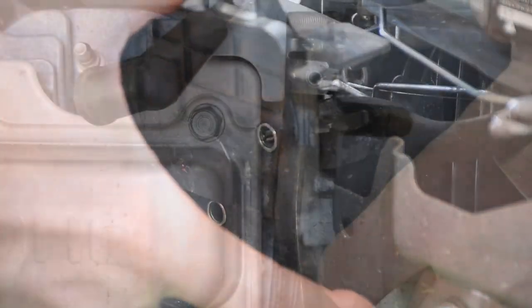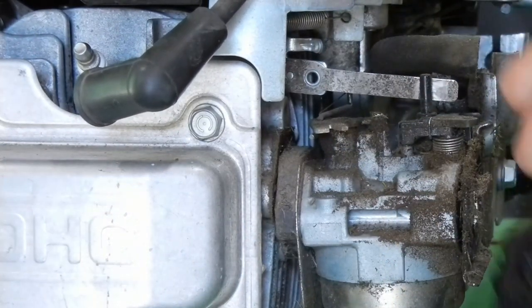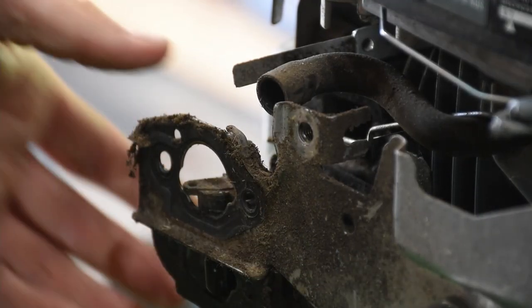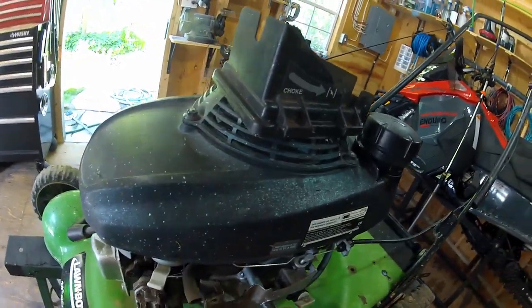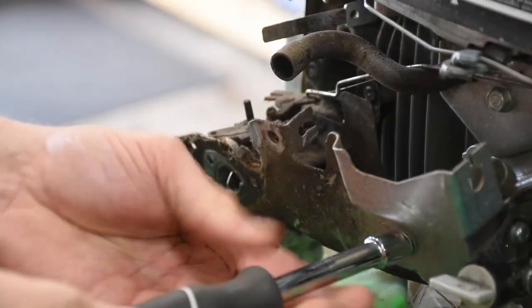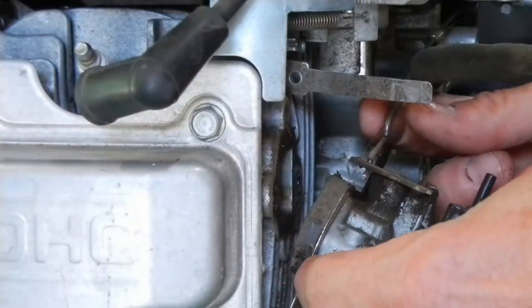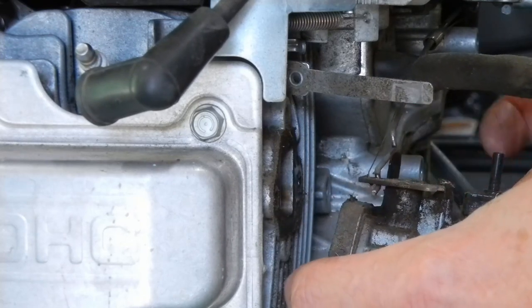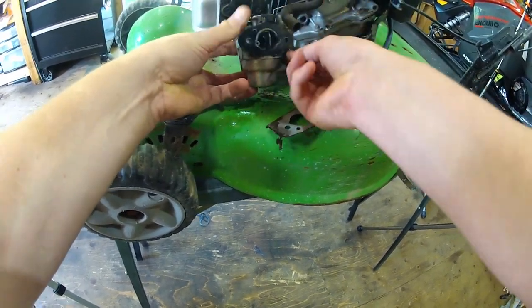Once you get them out, the shroud pops right off. You're going to see there's a little pipe — that's probably positive crankcase ventilation into that shroud. Let's take off this little metal shroud — there's only one bolt holding it in and we just twist it off. Now you can see the whole carburetor is loose and it'll come right off. Look at the access — we can see all the different components, the linkage back there, a small spring connected right up to the throttle plate on the carburetor itself. I want to make sure I know where that little tube is routed when I take it off.